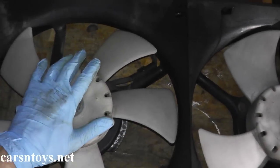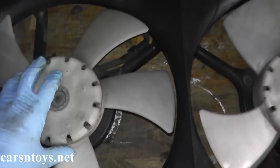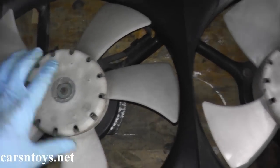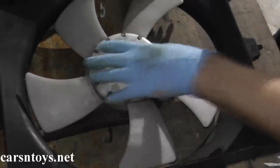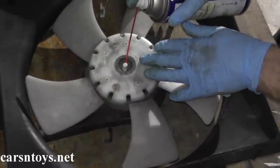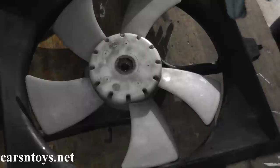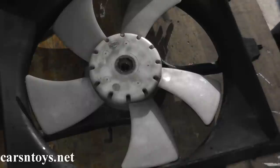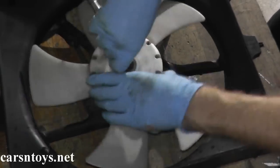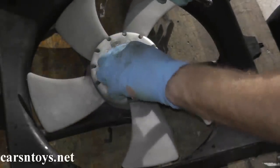If you're curious on how to test these out of the vehicle, I'll include a link — just click on it and a separate window will open showing you how to quickly test them. Before we remove the motor from the housing, I'm going to remove the fan blade. There's a little nut — this happens to be an 8 millimeter nut on top. I'm going to spray a little bit of WD-40 and remove the nut.